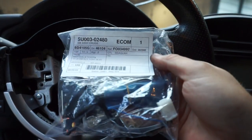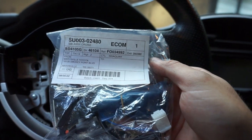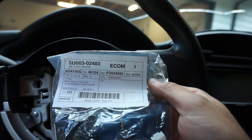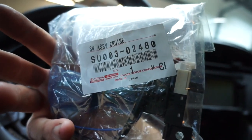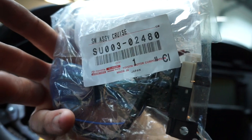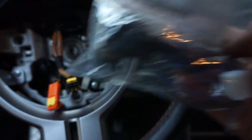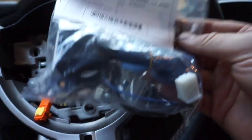So I went to Toyota — which is funny, I think this might be a Subaru part number. Let's look here. Yeah, it is actually a Toyota part, but it says Toyota Lexus. This is going to be the cruise control stalk that goes right here. It's a new one. Unfortunately, I just needed the wire between here and the clock spring, and they didn't have it separately. I had to buy the whole thing.